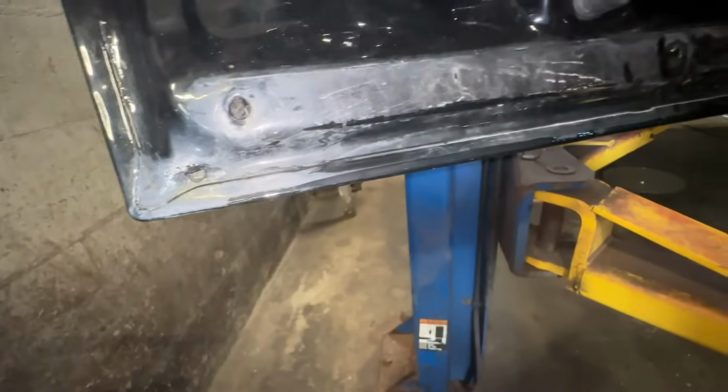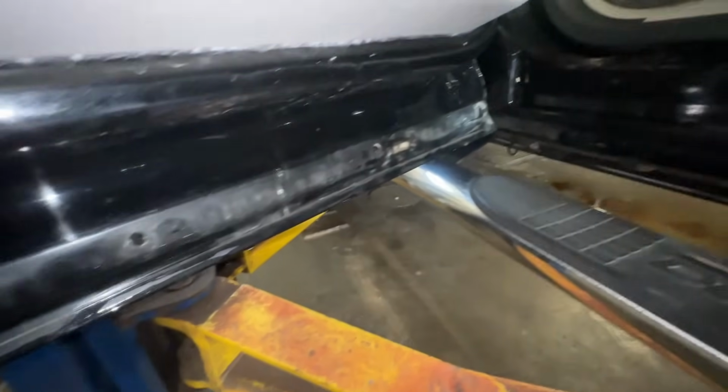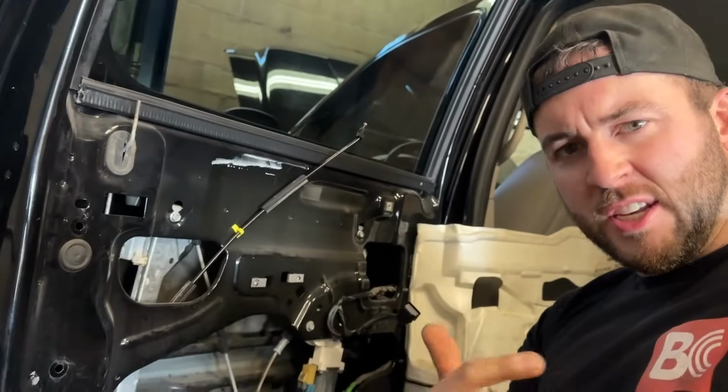We caught it in time probably, but I don't know how I'm gonna get that glass out. Try some compressed air and just do the best I can, because it's down the whole length of the door, so I don't know if a window got busted out of this thing or what, but we've gone this far, just figured to do it the right way. Pulled the door panel off, and this gave us easy access to spray the aerosol down into that big crack there. I also hit it at the bottom like I did the other side, just to be safe. But there was a ton of glass in here. I spent probably 20 minutes trying to clean that out between compressed air and the vacuum. So I think it should be pretty good. I think leaving that probably would have been detrimental and would cause some long-term issues with this thing rusting. So glad we got that figured out.